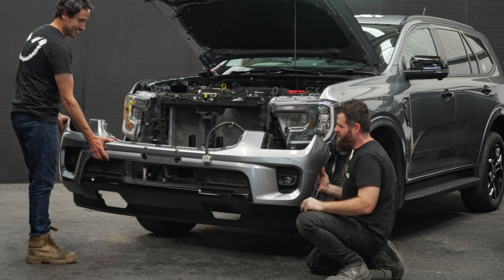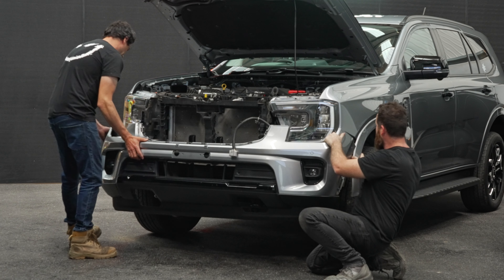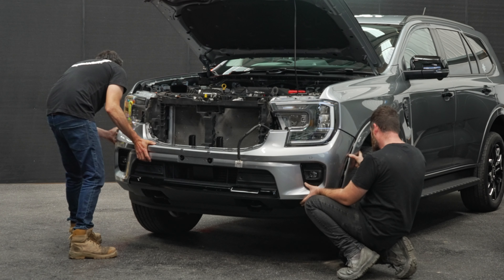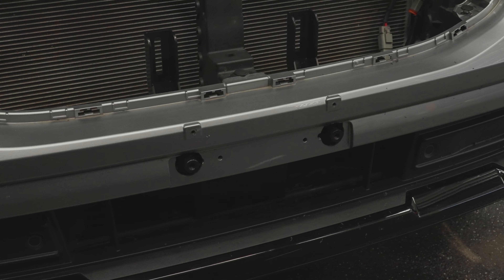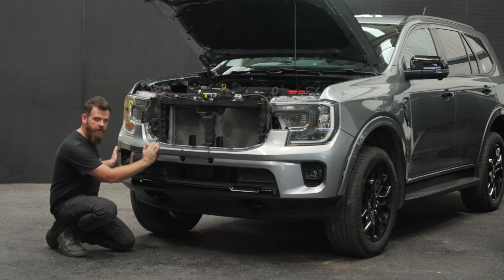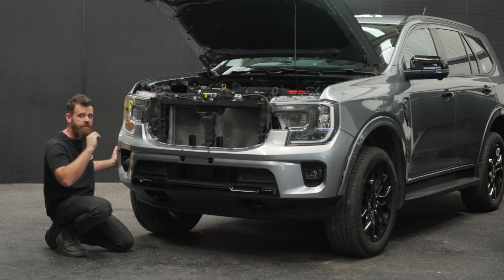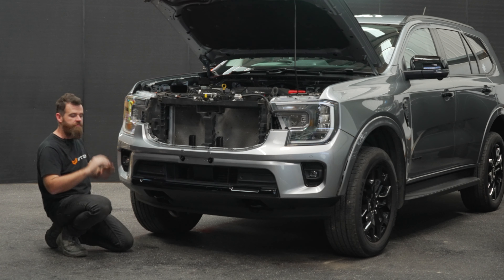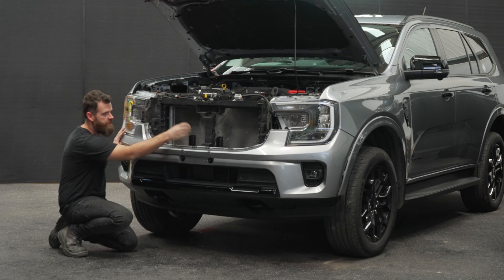Grab one of your most trustworthy friends — they're going to have to hold the other end of the bumper for you. Very carefully pull the flare out, offer up the bumper, and remember that clip in the center that was holding the weight of the bumper — line that up. Make sure the studs from the main chassis bracket are protruding through, everything is lined up, and click it into place. Bumper is reinstalled. Pop all the clips, all the bolts, everything back together. Three bolts in each side, the bolts underneath, click the flares back in, get it all bolted back. Then we'll move to installing our cage nuts.